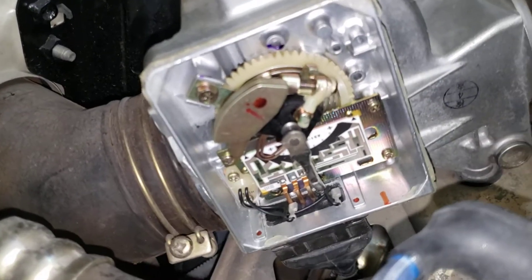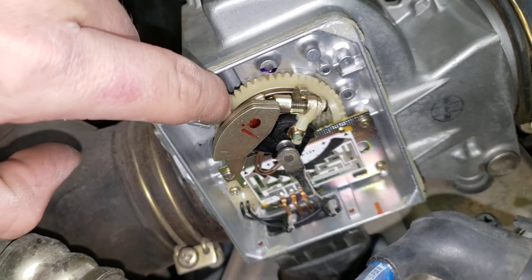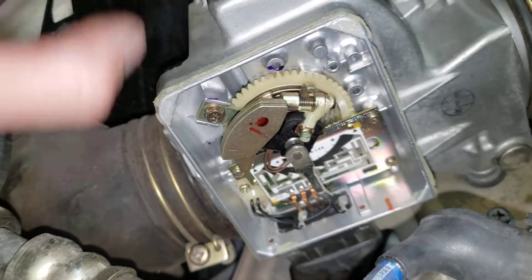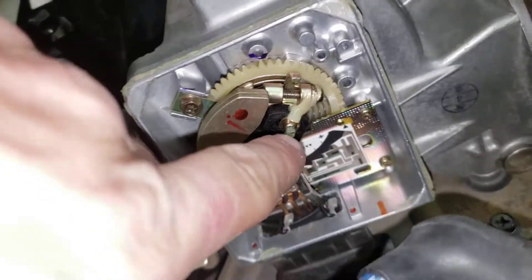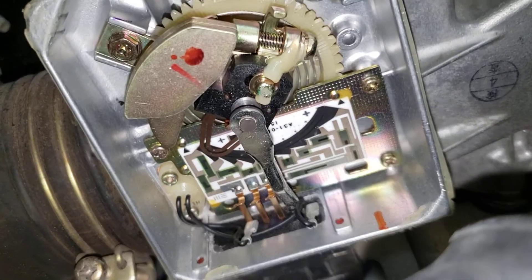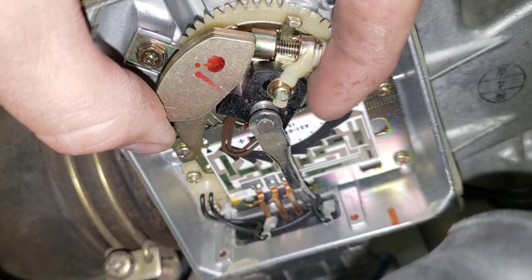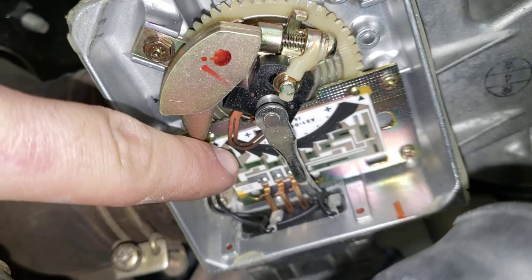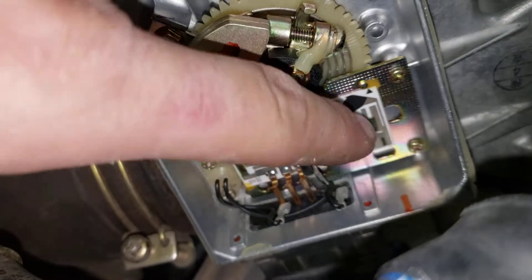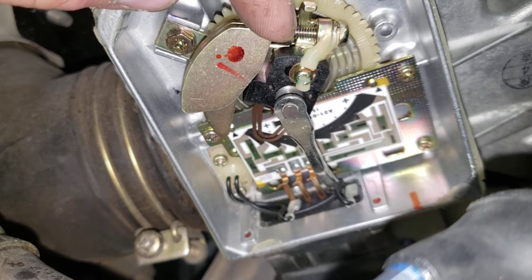There are a few things you can do. You can adjust the preload, which would be loosening this screw here and then turning this cog to tighten that spring back there — that's your spring preload. The other adjustment is this screw right here. That black plastic piece is slotted left to right, so you loosen that screw and push it one way or another, and it will move those two little copper fingers, which are the wiper arms for this little board. Moving them this way would richen the mixture, moving it this way would lean the mixture.